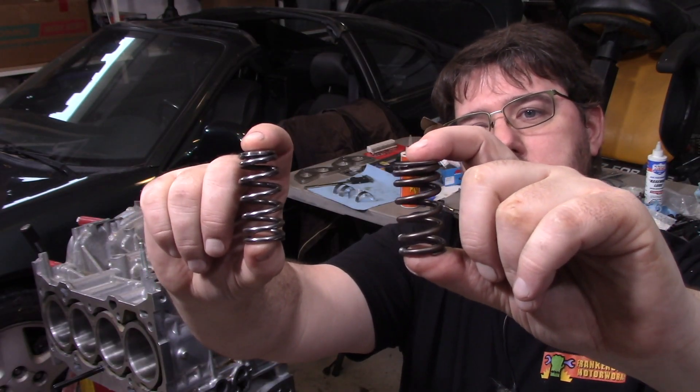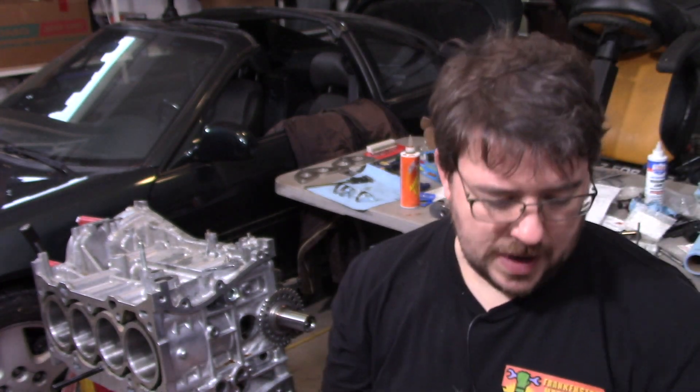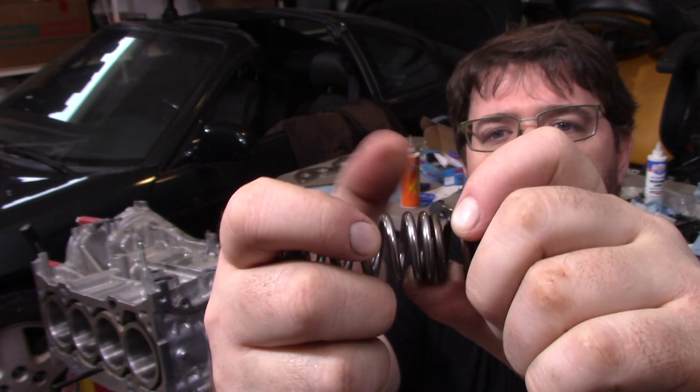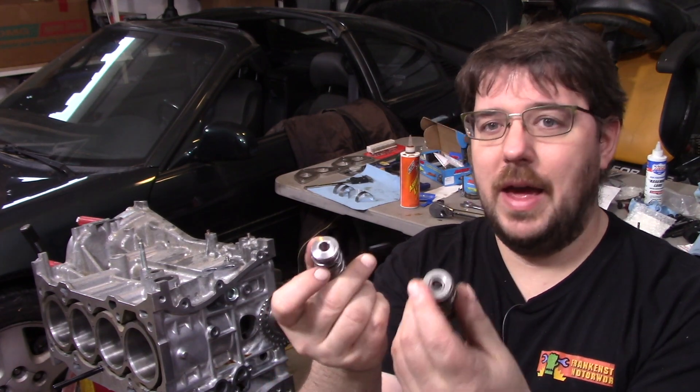This is a beehive design, and this is just a straight design. The factory one is actually a little bit loose on the retainer. From what I understand, if you can restrict the spring motion as much as possible, it'll have a longer life and you're less likely to build harmonics. The one I'm picking is just a light interference fit — the retainer doesn't actually fall out. The other thing is the diameter on the new one is actually a little bit bigger at the bottom than the previous one, and surprisingly that gives it a better fit in the bucket. It has about a half millimeter of clearance all around, so it should control the motion of the spring a little bit better. As an added bonus, the retainer weighs four grams less. It's not a whole lot, but on high RPM, four grams will make something of a difference.